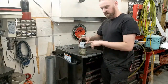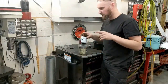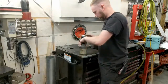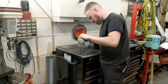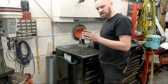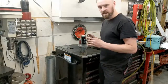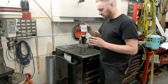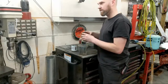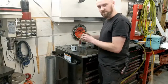Anyway, so one of these filters was on the vehicle to begin with. And I gotta try and recap. The video will cover it, so I'll have it there. Oh, here, I know how I can tell. I'll just pour some oil out. Okay, so one was on the vehicle as is, did not mess with it. I pulled it off, put a new filter on, drained the oil, filled it with ATF, and then I put this filter on with the ATF, and then I changed the oil again and went to the regular oil with, I believe, 3/4 of a quart or 1 quart of ATF, in replacement for another quart because I wanted it to get more time on it.